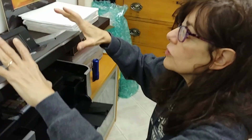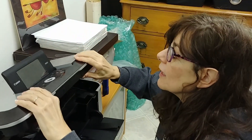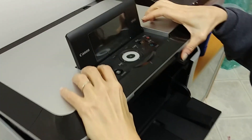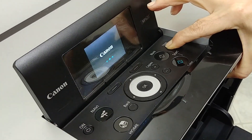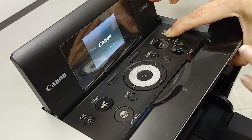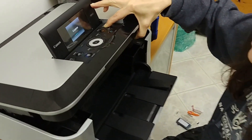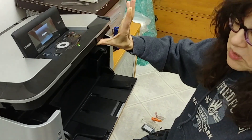There's another trick I learned — you always want to do this with the cover open, because it starts going through the process and gives you a little control and insight through the messages. This is the reset button — in earlier versions of this machine it's called 'reset,' in this one it's called 'stop,' but it functions as reset. What you want to do is hit the power and the stop/reset button simultaneously, and then once it starts, let go and hold the reset button for a minimum of five seconds. This allows internal diagnostics to take place, things to be cleared, and resetting however the engineers designed the reset button to do.